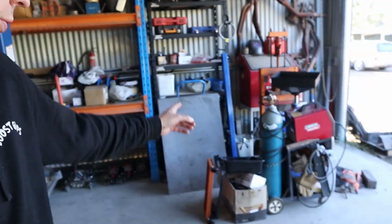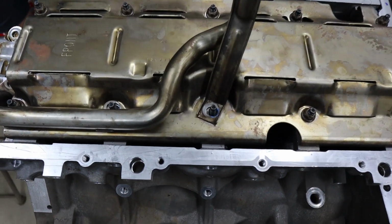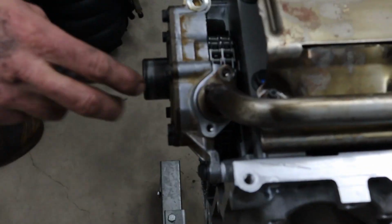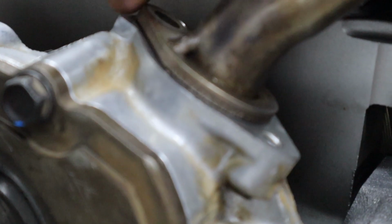And we do it in car. It's still quicker than removing the engine, but that's how you do it in car properly, so that you can modify the pickup and put it back on in a proper way. So you can see now with them holes elongated, the pickup bolts up where it should, and sits completely flat in there with no pressure or pulling either way.